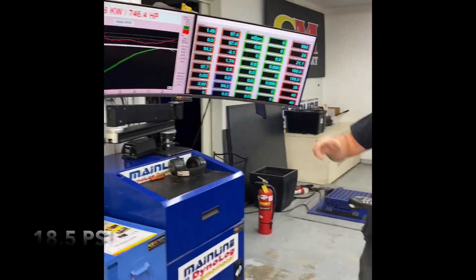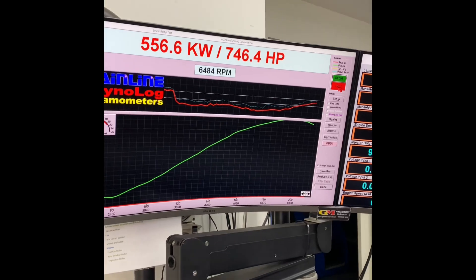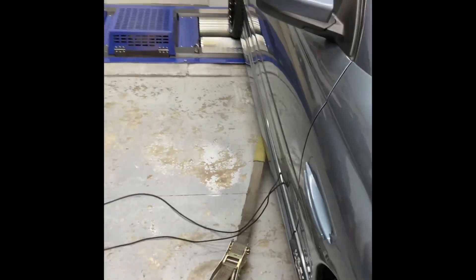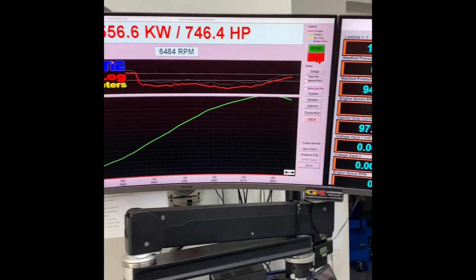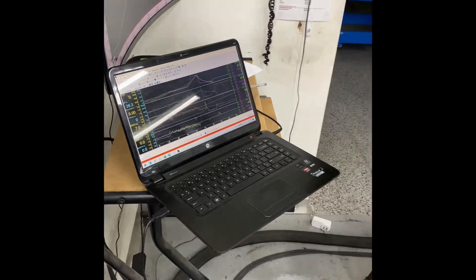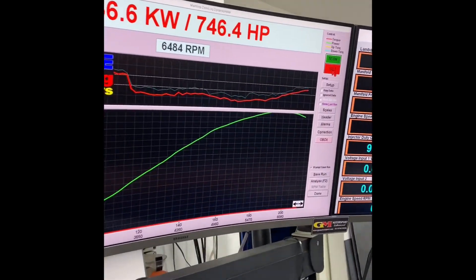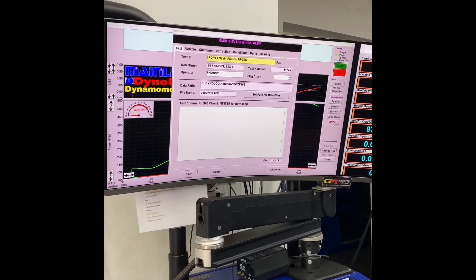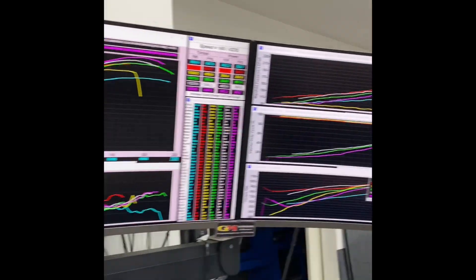Okay guys, you can see a very healthy 746 rear wheel horsepower — and that's no hub dyno. For a lot of people using hub dynos now, which is a really good product, that's on the wheel dyno so you can look it up pretty well. We're using EFI Live for all the data logging on that particular run and tuning with HP Tuners on the E40 platform. We are out of fuel, so no more for that — it's still safe, it's rolled over its peak power anyway. That's a great result for owner Glenn.